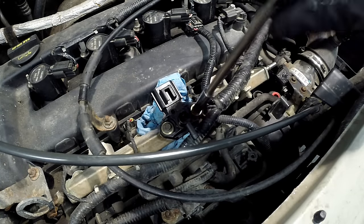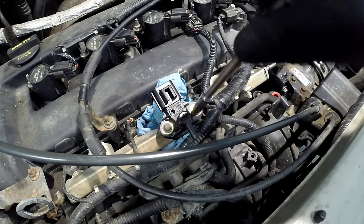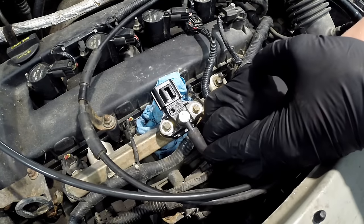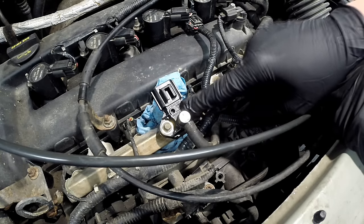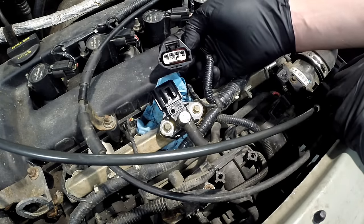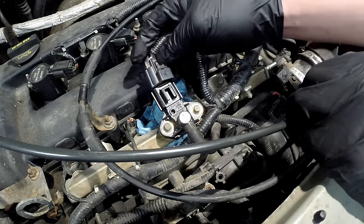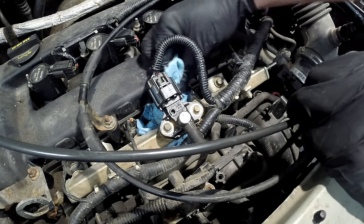Hand tight with a quarter-inch is just fine — there are brass inserts in there for strength and it's not going anywhere. Put the vacuum line back on nice and straight — push it straight on so you don't break the nipple off. These sensors are expensive, but you can get them cheaper on Amazon — link down below. For the connector, make sure it's free of corrosion. Put a little dielectric grease on the pins to protect them, then clip it in until it snaps.